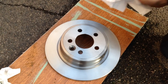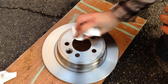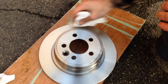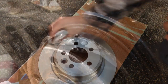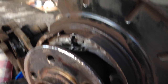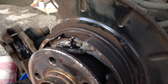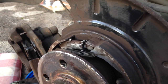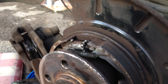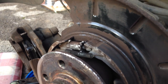As you put in your disc, it will come with some sort of grease on it — give it a good rub down, because obviously you don't want this on there when you're braking. We've just tightened the adjuster by pushing it upwards and that's just expanded the shoes. So it should go on, but it might be a bit tight — if it is, just ease it off slightly. This allows you to then loosen it once it's on so it's nice and free but not too tight, giving you a nice balance.